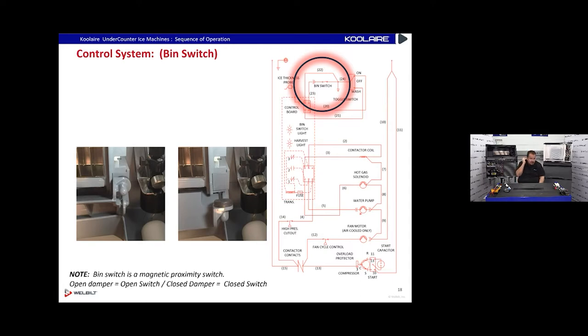I used to go to a lot of service calls where the machine would run in a clean cycle but wouldn't run in ice. First thing I'd do is use my eyes and look to see if that black disk magnet is on the damper door or if it broke off. Take a good look — it's about the size of a nickel and it's thick. When it breaks off it leaves a little black shaft behind. That shaft is not the magnet — it needs to be that nice big disk. There's a square hole on the magnetic switch box — poke something in that hole to release it from the evaporator and pull towards you to remove it.